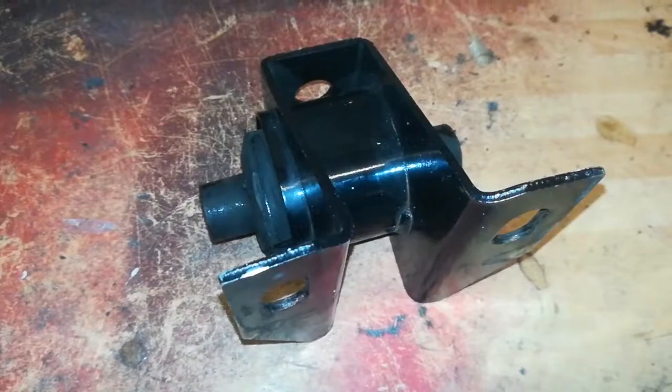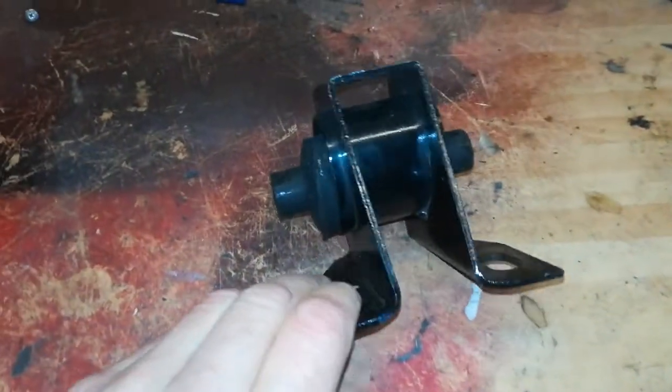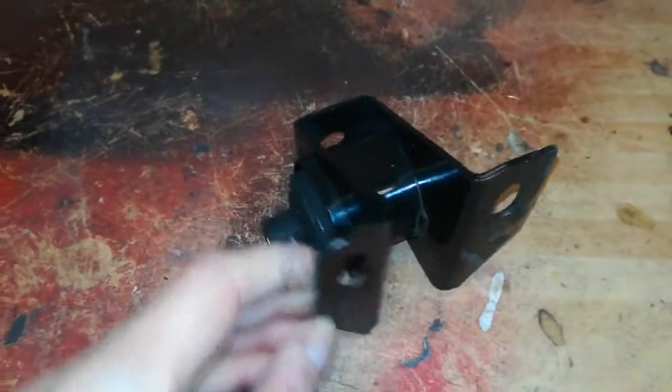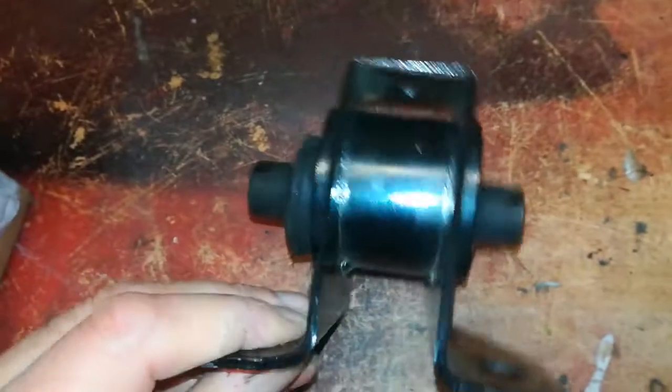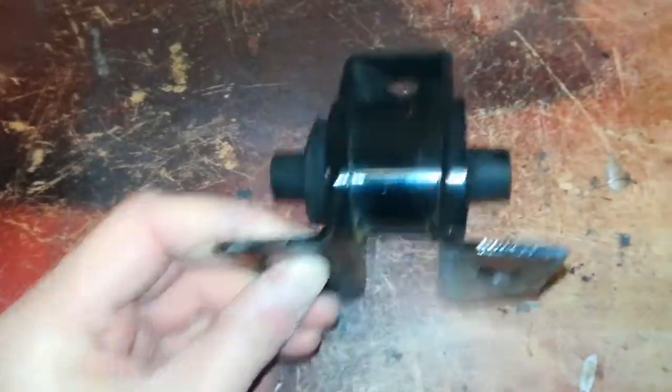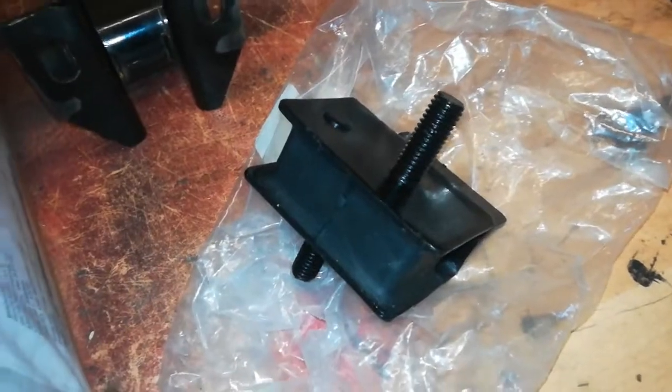Talking about the transmission issues - this was a brand new gearbox mount that we fitted in a previous video. As you can see it's now on the bench, because the vibrations and shuddering have actually ripped it out. The bracket or bush is no longer central - it's actually come out almost a centimetre where it's been laterally ripped and shaken. There's another brand new one on the vehicle now, though I think it's already doing the same. In here we also have brand new engine mounts to try and sort out the juddering. Hopefully this little update has shown you what we're up to - stay tuned and we'll hope to see you soon. It's chuffing cold out here, back to the kettle!